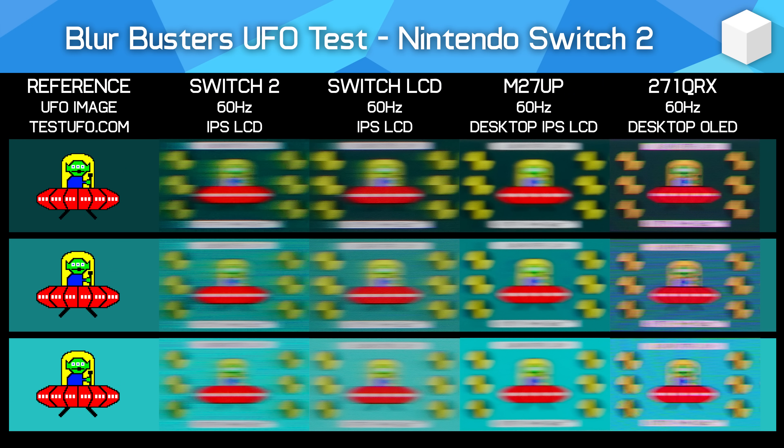While the measured transition time data is definitive about the slowness of the Switch 2's display, it might also be a good idea to look at Blurbuster's UFO test results. As you can see from these images, the Switch 2's LCD is very blurry in motion with extreme ghost trails following moving objects — there is no definition whatsoever in the UFO. Compared to the Switch 1, both results are overwhelmingly blurry, but on close inspection the Switch 2 is worse. The bottom white bar has a much longer blur trail and the blur behind the UFO's yellow body extends much further, almost to the edge of the red body, and inside the cockpit there is less definition.